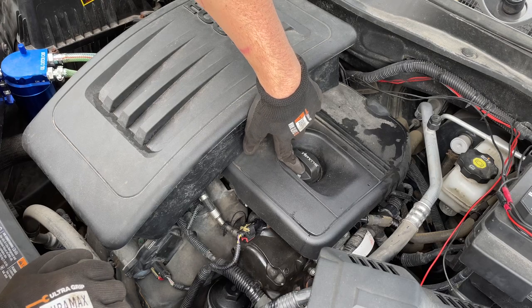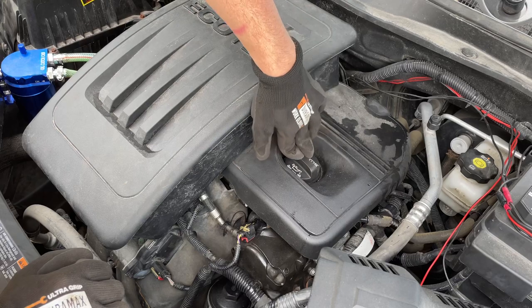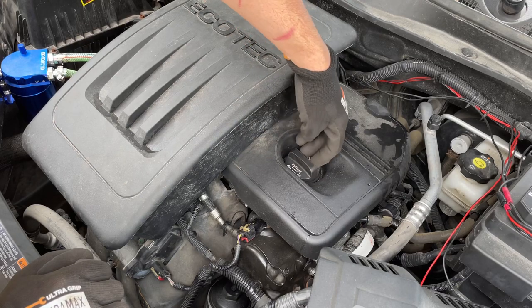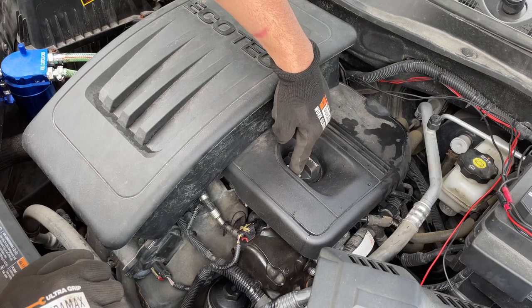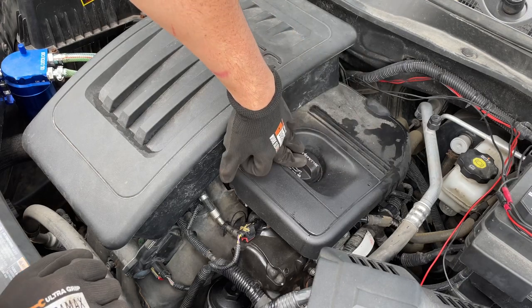This vehicle had that so bad — it also had water droplets forming underneath that would pour off as I took the cap off, as well as beads of water all along the inside of the rim of the valve cover.